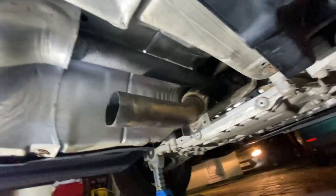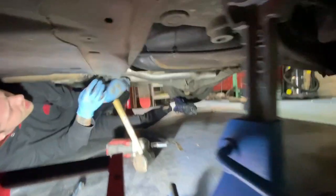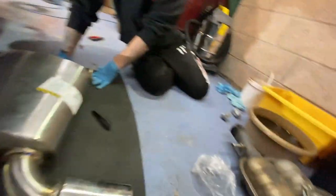Downpipe's on, prop shaft is now bolted in, everything looks good to go. We're going to go ahead and put the bottom exhaust mount on and start putting the extra pipes on and get the lambda sensors in. Back box is going on - I've put the bracket back on and I've also got the valve mechanism for the valves off the standard exhaust. We're going to get this fitted up and put all the nice new clamps on. Lambda sensor is in, whole exhaust is now together.